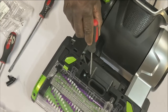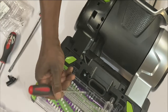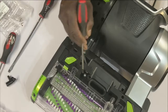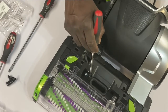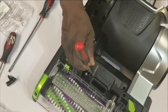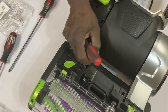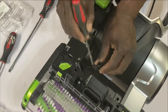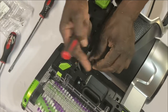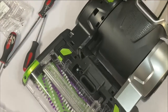So, to avoid this problem, guys, okay, what I think happened is the person that was cleaning this out, maybe some debris, pushed too hard down, did not realize this was a very delicate film right here. Very delicate stopper, okay? So be careful when you are trying to get lint out of here, or if someone tells you to prime the pump or something like that and they tell you to push down in there, because you can destroy this thing, and that's what happened with this. That film that's right here, it's busted, all right? And then the water's just oozing out, okay? So, that's that, guys.